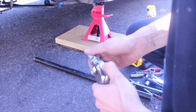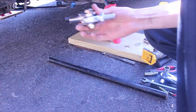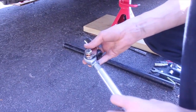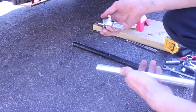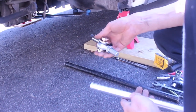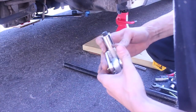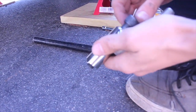This is the offset rack spacer. It's different than the one I saw in the picture, and it's definitely better. I'm essentially going to put this into the rack and then the tie rod they gave me goes in here, and this will go to the knuckle. I actually bought OEM tie rods because I thought I needed them for the kit, but this tie rod is included. I'm happy it's as bulky as it is because the roads around here are pretty bad — it'll take a lot to bend this. The offset rack spacer isn't as sketchy as I thought because there are slots in it that lock in, so it shouldn't be too bad.